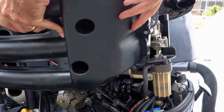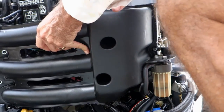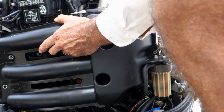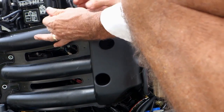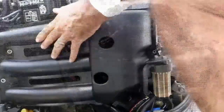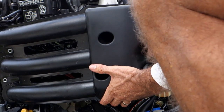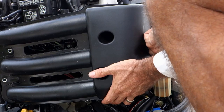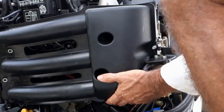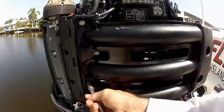Taking the intake manifold — obviously there's only one right side, this goes towards the front. Four attachment bolts and we just put it in position and reinstall the bolts. I'll start with one of the aft bolts — that'll probably be the easiest — and then take one of the number 10s here in the front. Hopefully that'll help me line up all the rest of the bolts. Again, all the bolts are the exact same size, so I don't have to worry about which one goes where — that should make the process a little easier.